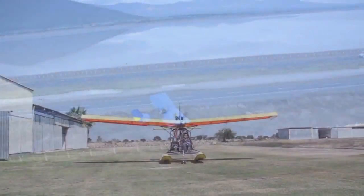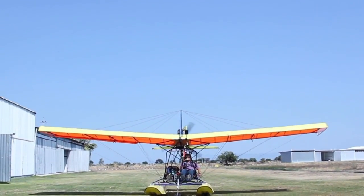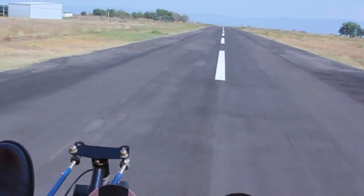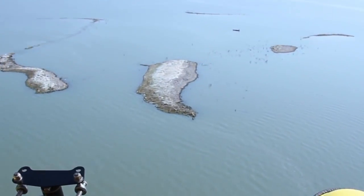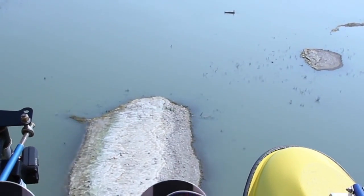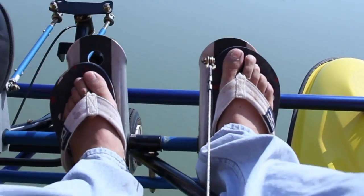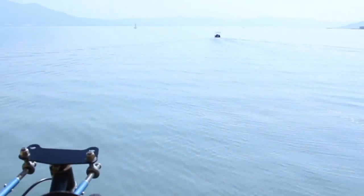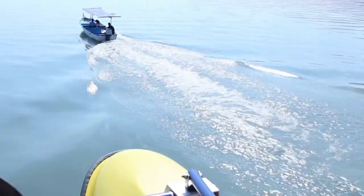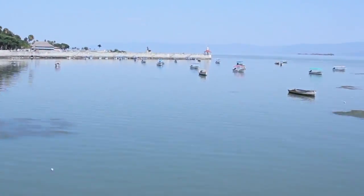I personally have used it for 25 years — that's how I started out in aviation. It was an MXL-2 Sport with a 503 engine, but it did a great job. This one has a slightly bigger engine. On floats and amphibious floats, it usually requires a little more power to make it work. We have the 582 Rotax, 65-horsepower water-cooled engine on this one. On the float planes, we also upgrade to a C gearbox or an E gearbox, which changes the reduction ratio so the prop runs a little slower. You can extend the blades, giving more thrust to get out of the water quicker.